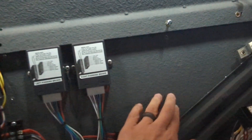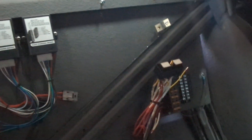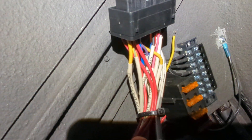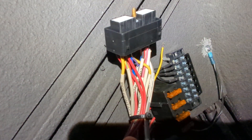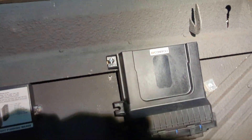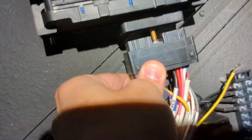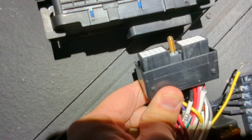When I wired up the car I needed a lot of room to mount components — some of the relay and fuse wiring, the parking brake controllers, and then I've got the T2C mounted here. I added this firewall panel — it's aluminum and it's been sound deadened — so I've got lots of room to mount components on both sides. I've labeled everything on the T2C wire harness to make it easy for maintenance, and I started using heat shrink labels. I've also become a big fan of rivnuts — they make mounting very easy and secure.